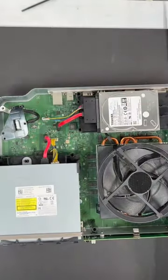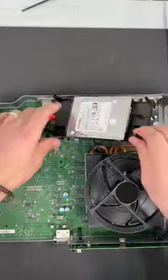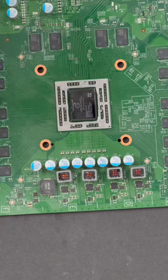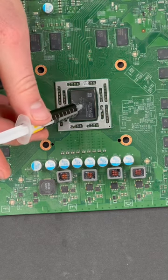So now we have to clean — basically using alcohol, acetone, and nail polish remover. The best thermal paste you want to buy is the MX4. I'm going to link it in the description below — you can get it from Amazon. You don't have to use much; that's more than enough.